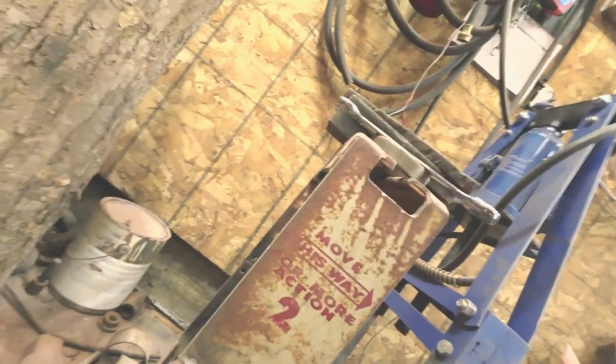So this is the tie rod end here, up to there, right? Back up, and then right here, this is the shaft into the rack and pinion stuff. And then this is the locking nut here. So this is how you adjust it. You just turn this shaft back and forth until you finally figure out it's right. And then I'll have to hold this shaft straight and tighten that nut onto there, and that locks it in place. I should have brought my wrenches with me because I could have done it while I was here, but no, I didn't. Okay, I'll get out here and I'll get my wrenches and I'll tighten that up. Okay, that's good.